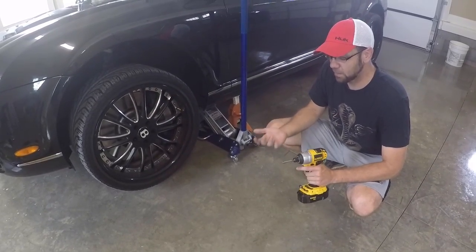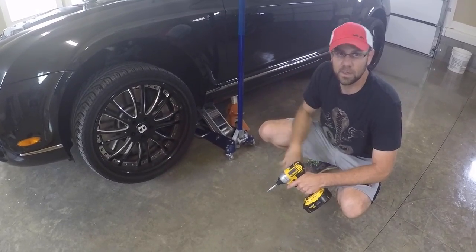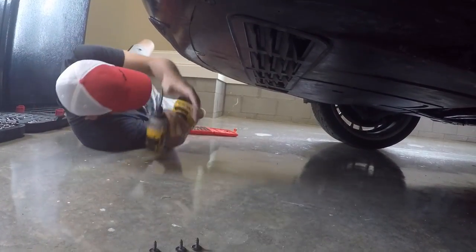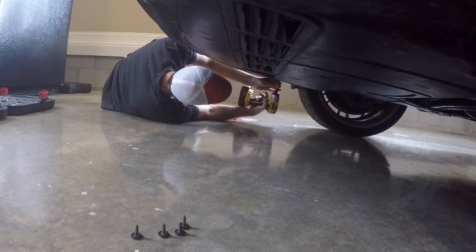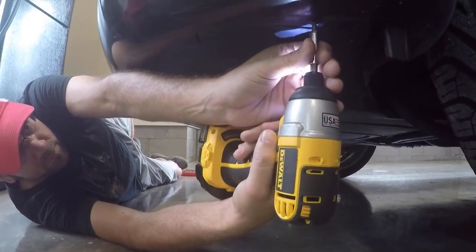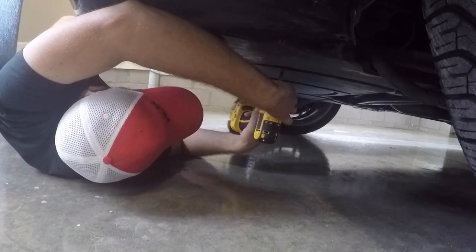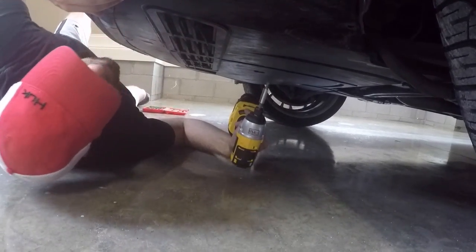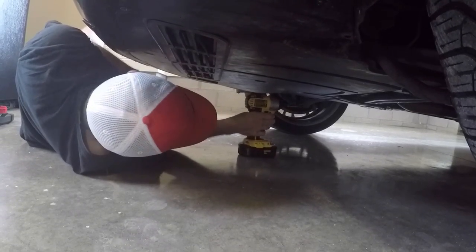I think that we have enough clearance. Now I've got to use a T25 torx bit to take off about a thousand little bolts that hold the under tray on. Next time you see me, I'll probably be under the car. Turns out there are some T20s and looks like some T30s as well. Good God, can they add more things under here? Alrighty, I'll take those off.